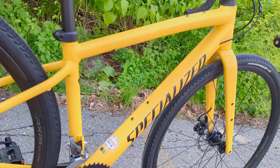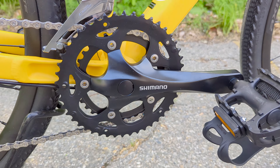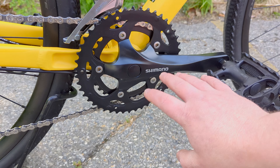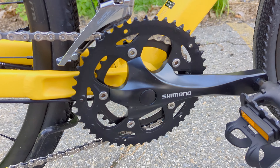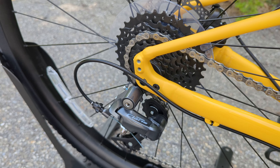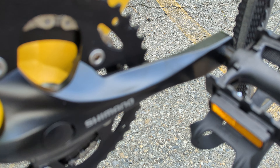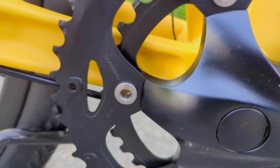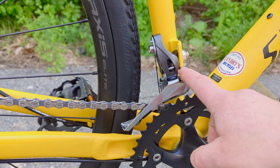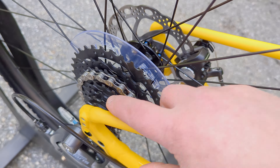For the most part this bike is going to do a lot of pavement riding, even to and from your gravel rides. Up front is the Shimano RS200 crankset — an interesting combination of subcompact and compact chainrings. It's a 5x110 setup, the normal bolt pattern for a front crankset, but running a 34 tooth small chainring and a subcompact 46 tooth outer ring, rather than the traditional 50 tooth compact. Out back you've got an 11 to 34 spread on the eight speed cassette, operated via a Shimano Claris rear derailleur.